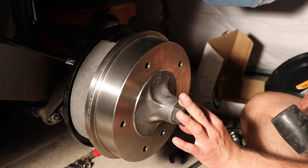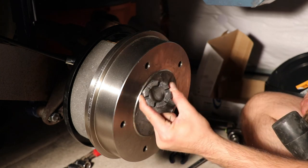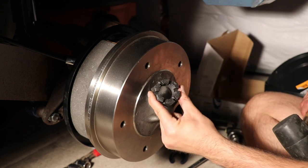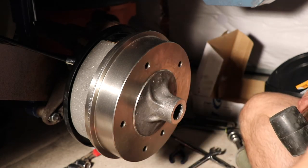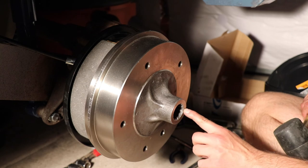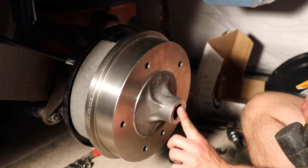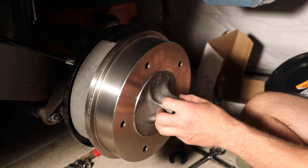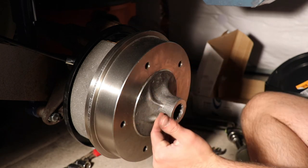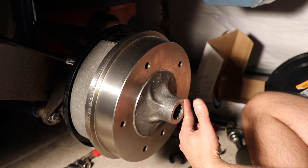As I was installing this particular drum, I noticed something quite alarming. I measured where the bore comes through from the inside of the spline to the outside — we're at 11.3 millimeters on one side, and completely 180 degrees away we're at 9.6, 9.8, even 8.6. This drum was not reamed out in the center — it was reamed out offset. That is extremely concerning. I will not be running this drum. I'll be contacting CIP1 for a replacement. The brand is 'Original, Made in Brazil, MDS' — maybe stay away. The other side was measured and is not like this, thankfully.